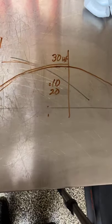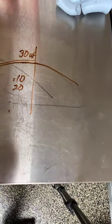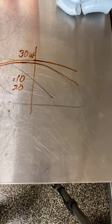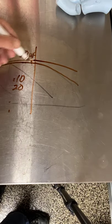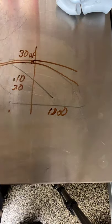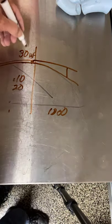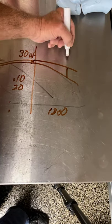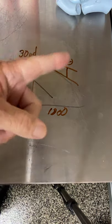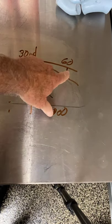Now, here is why. And this is just my opinion and what I think I've learned, and some of you know this, but this is news to some folks. With the vacuum pump on, the curve would look like this. Yes, it's only worth a little more horsepower because we only measure it at peak. But what about 1,000 RPM past peak? What if I told you it was twice as much there? Instead of it being 30 horsepower different at peak, it could be 60 horsepower at shift point or at the finish line. And if you're a normally aspirated racer, NASCAR, Pro Stock Car, Pro Stock Motorcycle, or some of these other Comp Eliminator style classes, you don't want to give away that much.